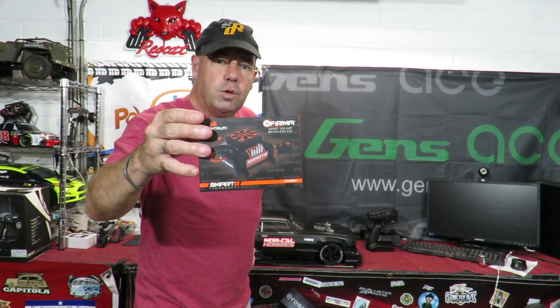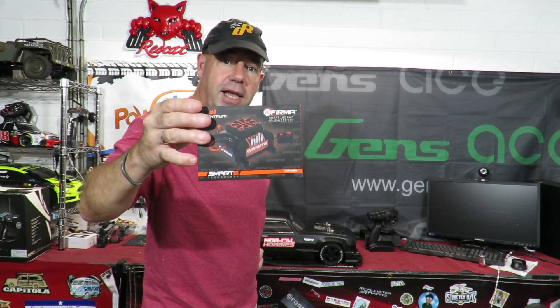When the car overheated after three minutes, somebody suggested it might be the servo causing the issue - absolute nonsense. The BEC on these things gives out something like up to six amps, and the servo is not drawing anywhere near that. There was clearly an issue with the ESC. I got through to Horizon on the chat - my opinion of Horizon Hobby customer service is absolutely skyrocketing. They fully agreed there was an issue, but major problem: they're out of stock of the 150 amp ESCs. Quite a few of you have also said you're waiting on a new 150 amp ESC for your Felony or Infraction. They offered me a 160 amp ESC instead.